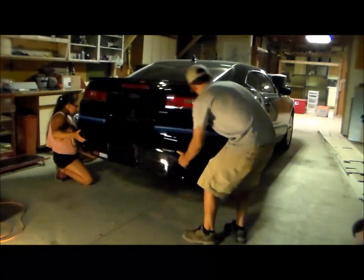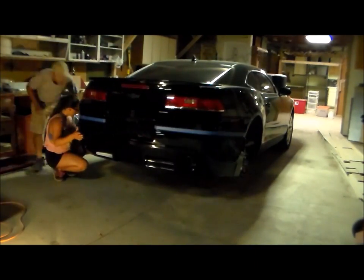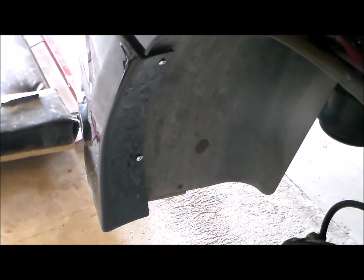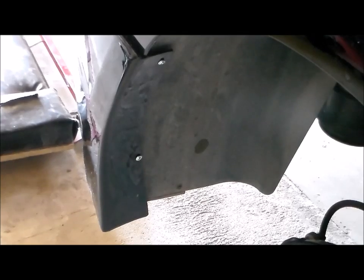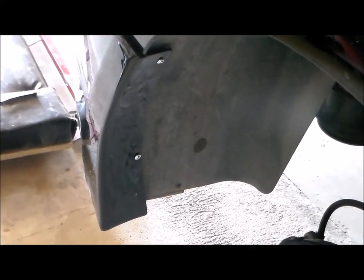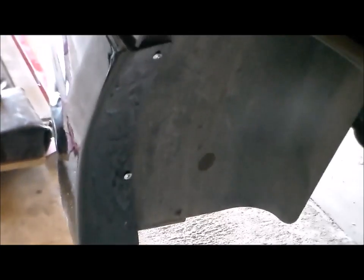So let's go ahead and slide that bumper back on and press it firmly into place. Now we want to make sure it's exactly lined up with the tape. We're going to go to the side of the bumper at the inner fender well and attach two screws — one on the top and one on the bottom for now. We're going to go back and touch those up later.